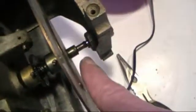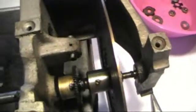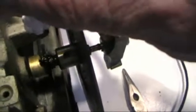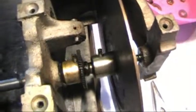I'm going to go ahead and remove this disc. The disc comes out with these two screws. This is the drive gear that goes against the governor. This screw holds the disc in place and they're both on this shaft — here's the top shaft that goes to the platter. In the bottom down here there should be a ball bearing, not so easy to lose because it is about the size of a BB gun ball. I'm going to go ahead and loosen these screws, and this whole shaft should pull up.